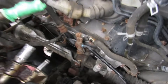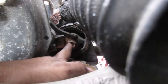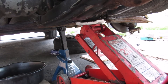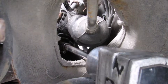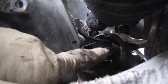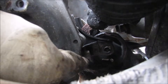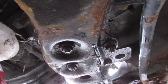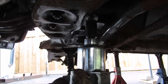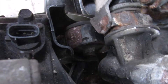Now that the axles are out of the way the next thing I'm going to tackle is this rear engine mount down under here. Looking from the driver side this is the bolt I need to remove. To take pressure off of the rear mount I'm going to jack up the transmission slightly. So the engine bolt is out, the next thing I need to do is remove this bracket — it's held on by three bolts. Next I'm going to remove these three nuts that hold the rear engine mount onto the subframe. I got the bushing loose but I couldn't get these mount brackets out so that's going to have to stay for now.